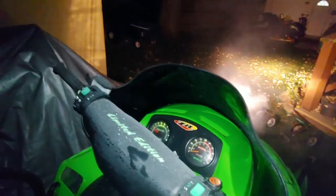Terribly loud. Well, that's good. Last year it seemed like it would take quite a few pulls. And granted, I had 35 pilots in there, but I also had a half degree bigger cutaways and mismatched needle jets. So that's good. About 1500, so I'm happy about that. Seemed a little rough at the beginning, so we're definitely gonna have to keep an eye on it either way.